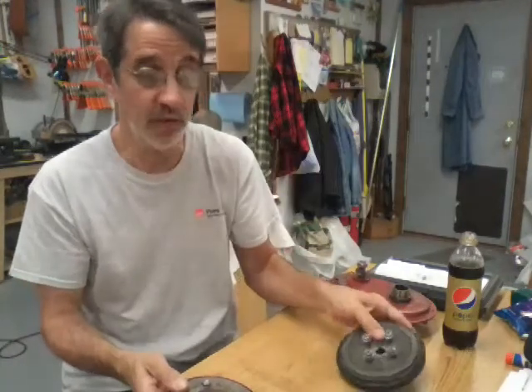The clutch plate bolted solid onto it — that's where I came up with the idea of bolting these solid. Now there's a problem with that: if you've got kids, these things will pop wheelies. On a rear-engine mower you have no weight in the front, and if you have a bagger on with a lot of material in the bag — like my yard, mostly sand — these things come up in the air very easily.